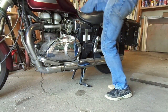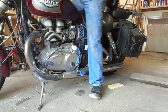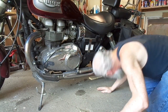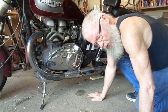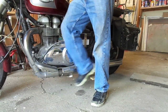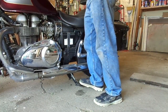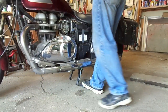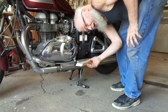Move that out of the way. Kick down off the center stand, kickstand back down. Putting the wood underneath the tire, just like that. I've got the wood in front of the tire, we're going to roll it up onto the piece of wood. Kickstand up. Take the center stand, put it down. Tip it so that it's centered on the center stand. I'm going to put my hand right here on the shock absorber and just rock it back like that and pull up. Super easy, super simple. Without that board though, it's quite the operation to be able to get it done.